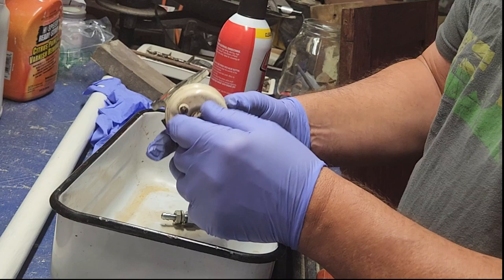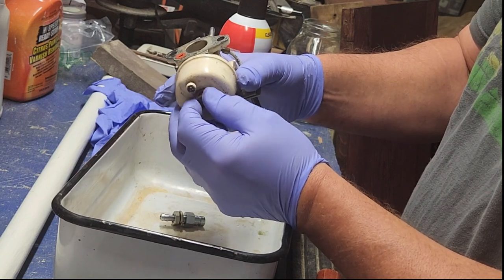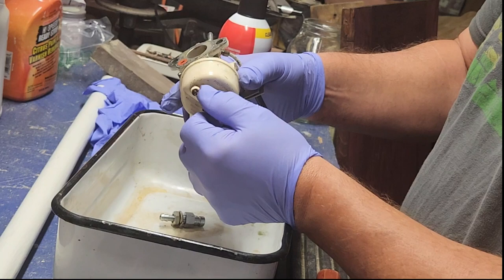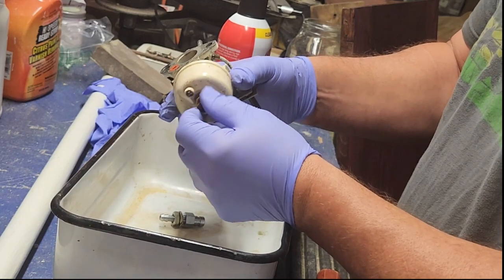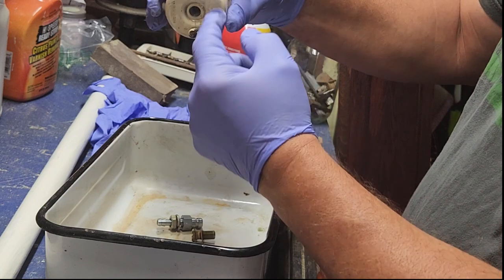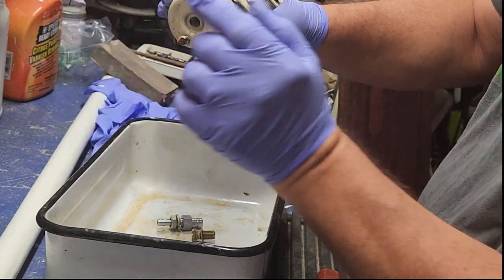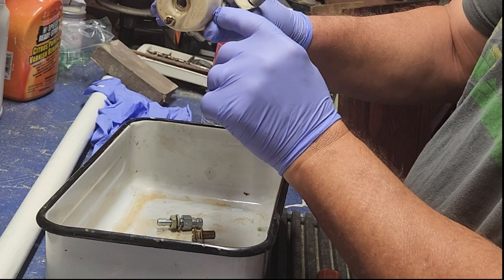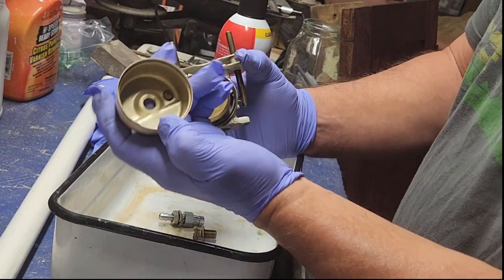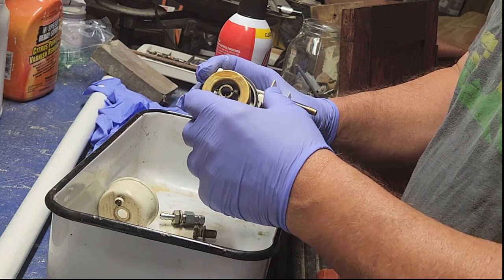We're going to go ahead and take this screw off — I bet this is where a red washer goes. This is a drain: in winter, or anytime you're going to let it sit, you're supposed to drain all the gas out and then turn it on and let it run until it's dry. This is a drain bolt. What's called a bowl — inside the bowl has a float. Mentally note that this is the front. The small side is right here, so I'm guessing the float will go this way. It looks really clean — if this carb hadn't leaked a little, which could have been just the hose I found a crack in, I'm not sure it needed work.